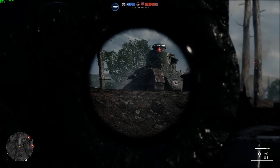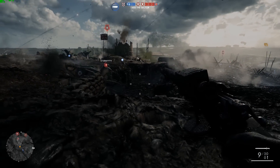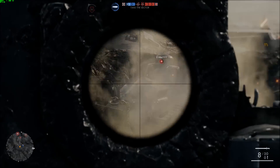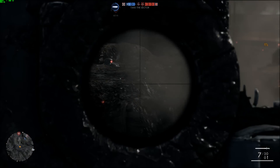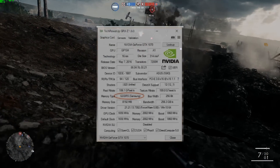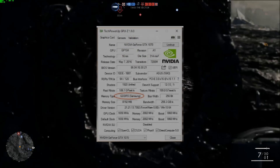There's an easy way to find out if you're affected by this problem. Just download an up-to-date copy of GPU-Z. I think you should always have a copy of GPU-Z or CPU-Z on your machine. Simply run GPU-Z and it'll give you all the specs of your card and it'll tell you who manufactures the memory on that card.